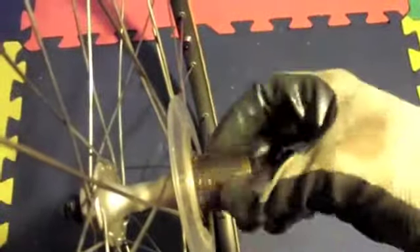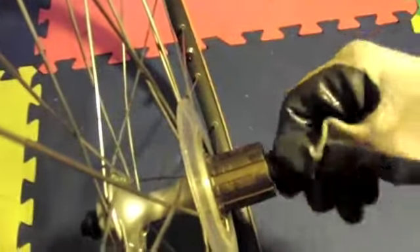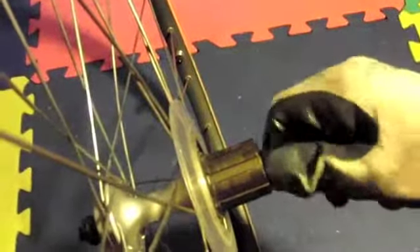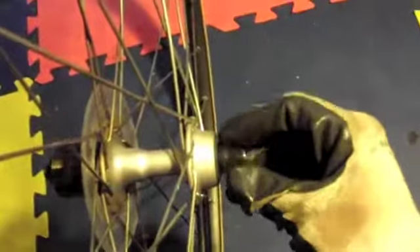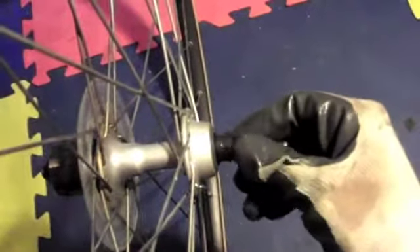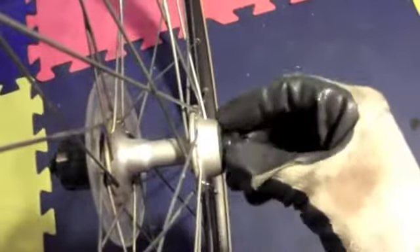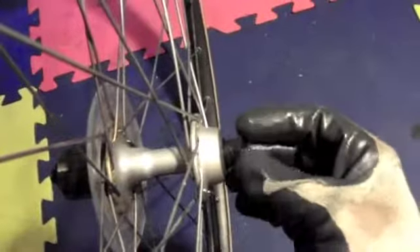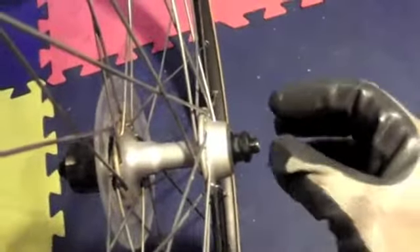The mechanism seems pretty good — it's not loose, spins pretty freely. Now I'm gonna turn the axle. I can feel it — actually it feels pretty good. But if you feel any stiffness or grating or grinding, you could take these apart and re-grease them. I should probably do that since this is a really old bike. If I'm gonna sell or give this bike to somebody, I don't want them riding along and saying something's wrong with it. So I'm gonna go ahead and take this apart. It requires some really thin wrenches.